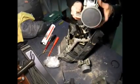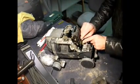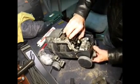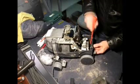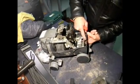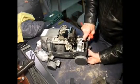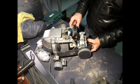Keep that in neutral and bring it off inside here. Drop that off again. Put that over the receiving piece and just bring it up here. Get that lever up and out the way — the lever needs to be up. We've got the belt over both cogs. The lever's up, drop them in. Make sure that fork goes over that receiving part there, and that is in place with the belt on. Then turn it over and put our three screws back in the bottom — three Torx screws and a Phillips in the middle which we don't touch.